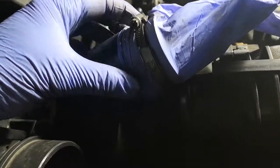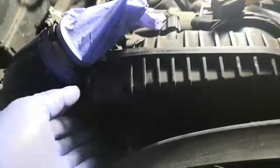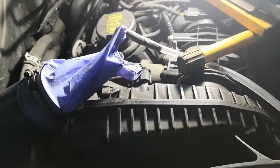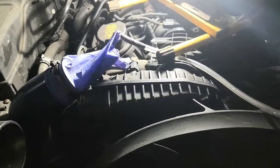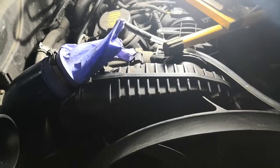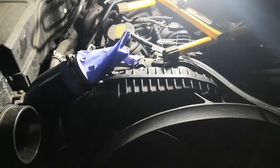It looks as if the little bit of oil I had was actually from the silicon pipes that were fitted — it was as simple as the jubilee connectors not being tightened up. So that's how to conduct a very simple smoke test on a Discovery 3. You can apply this to different parts of the system. The smoke is non-harming as far as I'm aware — obviously do this at your own risk. A little tip to save yourself a few quid and just double-check the system. I'll always try to keep on top of these things with my Land Rovers. Thanks for watching.